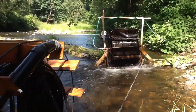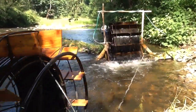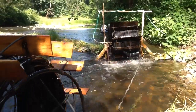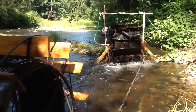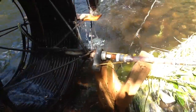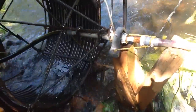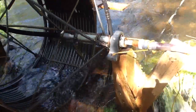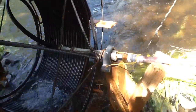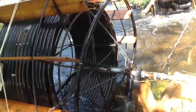You'll notice that I've switched sides on my exit. The reason I had it on the other side — the left side — was because it would unscrew itself. This one here, I put a retainer in. You'll notice that I've got a piece of wire drilled into a hole to keep it from unscrewing. So far I haven't had any problem, but I haven't run it that long.